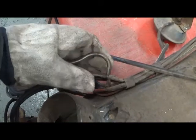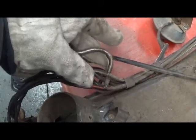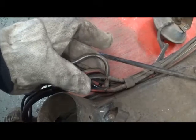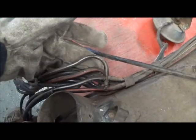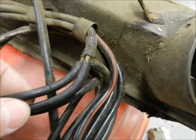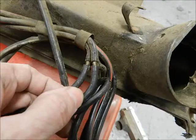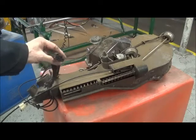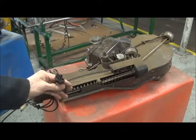See the T-splice? And there's two of them — one for the motor in one direction, one for the motor in the other. Number four vacuum motor is teed off of the system, so really it's no extra complication. It just works when one of the other three motors works, and she uses the same 7-pin vacuum system.